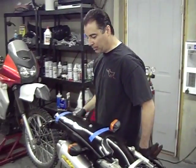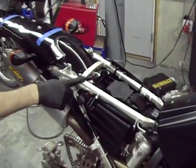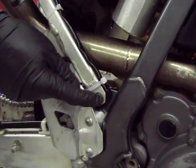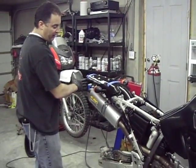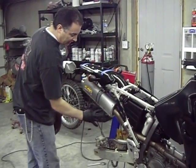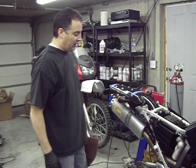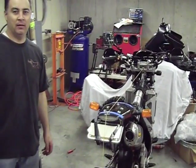We'll show you the back part of the plan - it's going to be a real custom deal. We do not want the subframe to hold the weight, because this bike has an all-aluminum subframe that's easy to bend. If you hit a whoop wrong, all that weight with a side force will bend it and you'll never get it straight again. So we're going to try to transfer all that load down to the frame bolt right here. They're in different places on each side of the bike so we'll have to build a custom piece for each side to support the back of the rack. We've never seen anything on a DRZ like this before so we're going totally from our own design.